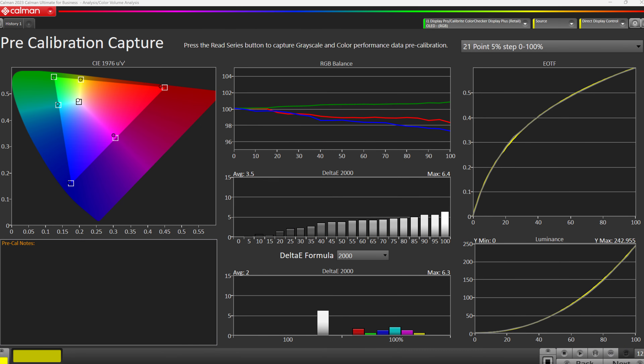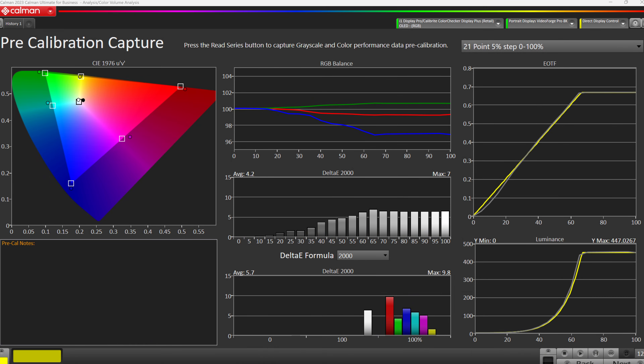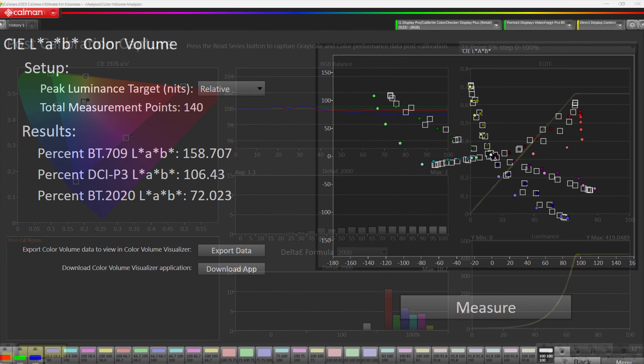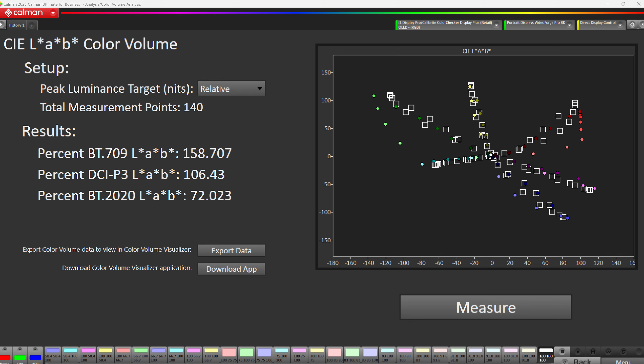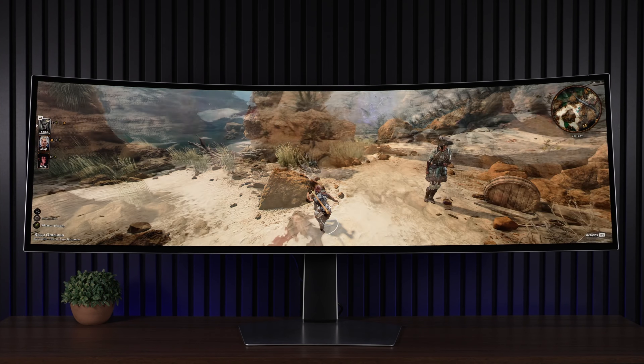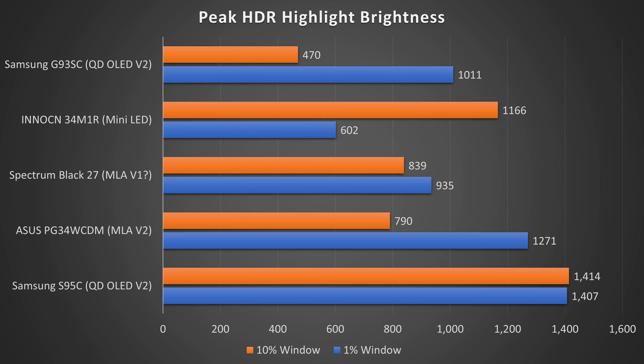In terms of actual accuracy out of the box, sRGB on a gamma 2.2 curve looks pretty good. The RGB balance was a little off, and I was able to fix that — I'll have the best settings linked in the description on my Patreon. For HDR, out of the box it is a little off, over-darkening some shadows, but I was able to fix this, and this problem exists for all HDR modes. In terms of color volume, it's absolutely excellent: 106% DCI-P3 in HDR mode, which is very impressive.